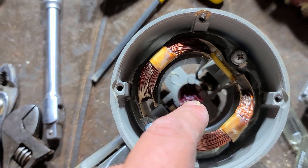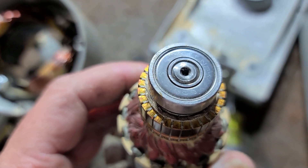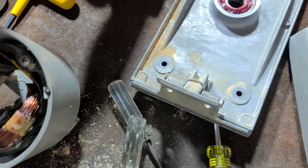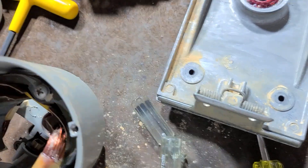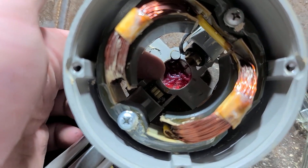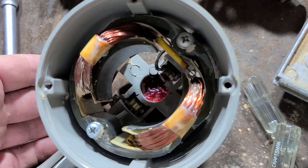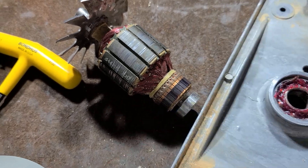And then you can see down the motor — this is all you can do for the bearing on the back because you can't pop out these metal shields. Those snap in pretty good, they're kind of hard to pop out to try to get against that little lip. And since they're not sealed, they're shielded, and there is a little gap there. You don't fill up that recess where the bearing seats, the bearing cup. You put just a little bit of grease in there so that when you push the motor in, that grease will force its way into the bearing. You'll run it for a second with the top cover off to see if any kind of squeezes out the bottom. That way you can use the corner of a rag to go in there and clean it up.